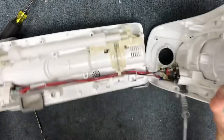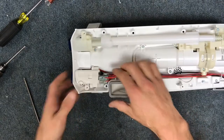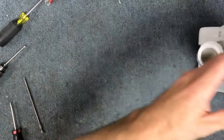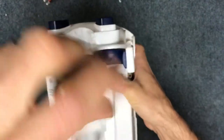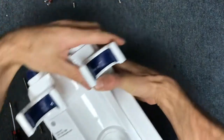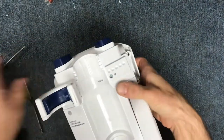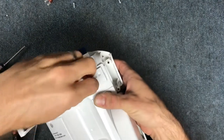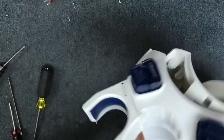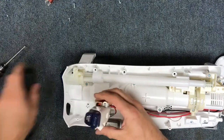Now you can see the guts inside. Here's a little secret: you're going to take out the tool clip — it's just a small Phillips screw — and then slide it out, wiggling it as you go. That exposes the screw that keeps the switch assembly mounted in place, and that is a small screw.